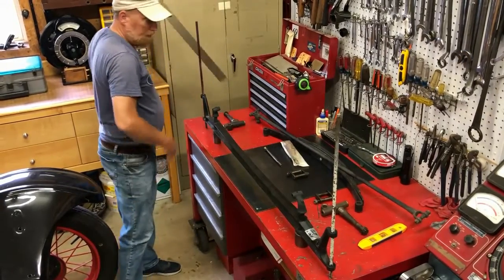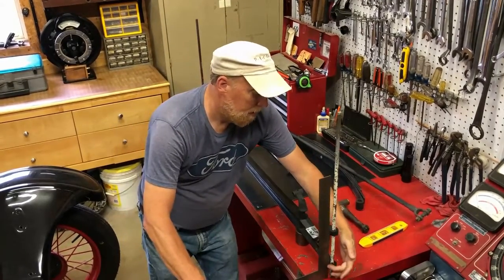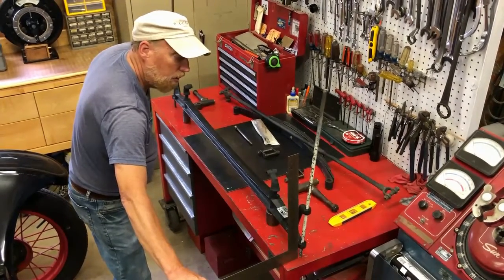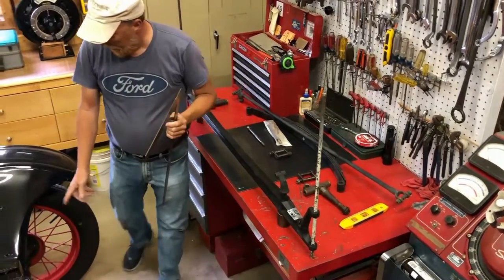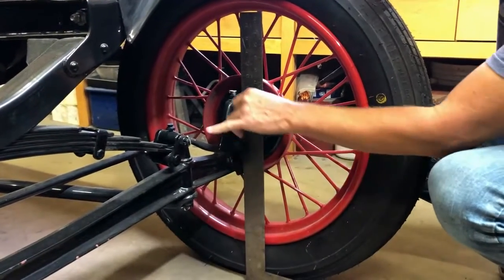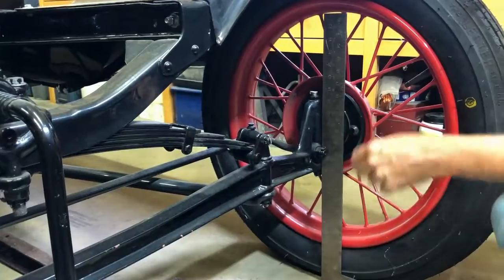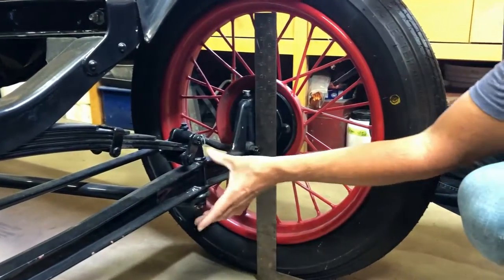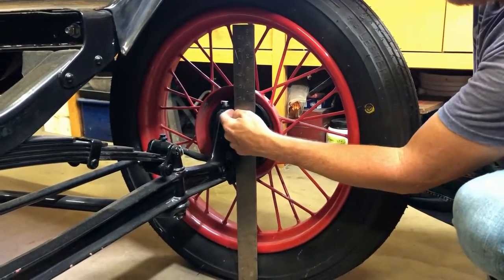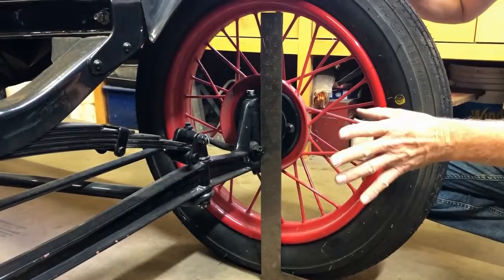The way you check that on a car is you put one of these bad boys down there. You're going to want about an eighth-inch gap between this point and this point. About a quarter inch, eighth-quarter — somewhere in there. Now we'll show you on this T here. This one's already set up. Here's a front axle on a '27 T that's already put together. Here are the spring perches — the little centering hole is to the back of the car, on both sides. This is your caster. These spring perches give you this caster, so this axle is laid back. You can see the gap up here — I can almost get my finger in there. That's the proper way of setting up the car; otherwise it will not steer right.